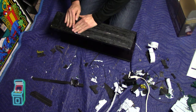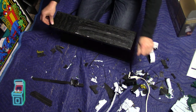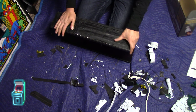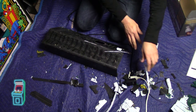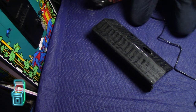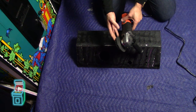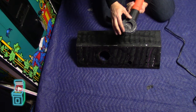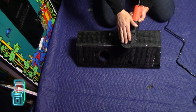I'm mainly done and picking up the stuff I dropped — it's a little tacky but I got most of it off. It does a really good job. If you've ever seen a Millipede control panel or Crystal Castles, it's pretty thick. Some of it stuck back on, so I'll clean it up a little more. Now I'm going to hit it with a grinder with a paint remover attached — I put a link in the description for these. This one still has some life on it but I'll change it if I need to.